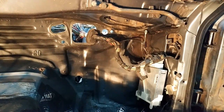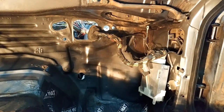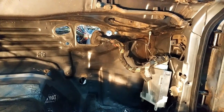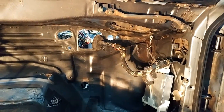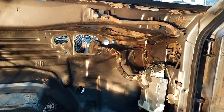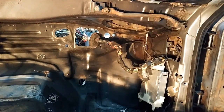One thing I've noticed by starting to put things inside is that once I put that HVAC box in, the ECM has nowhere to be hidden. The main bundle coming in through that AC hole is going to be severely tight to get that piece in — it was never designed to be that far inboard. It was always bent to be outboard like where the other one comes in, so I'm going to get the AC pieces taken out of the HVAC box, put that in, and start figuring out what fits and what doesn't.